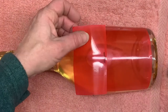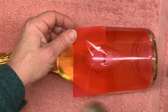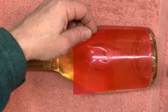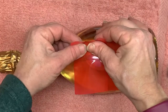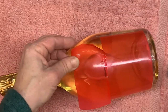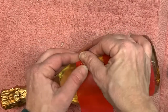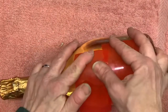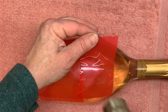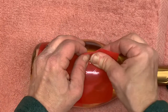Next, I'm going to peel back the carrier sheet. This particular film is a little bit on the brittle side, so to help with that I have a heat gun. I'm just going to heat up the film for about three seconds, then pull and shape it. If it starts to feel brittle again, hit it with a little more heat and continue to pull and shape. Turn it around and do the same thing to the other side — you don't want to use the heat gun too much or the whole thing will start pulling apart.